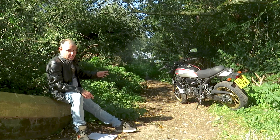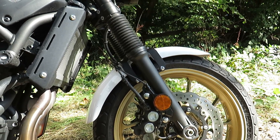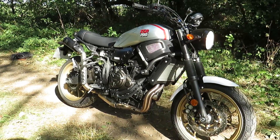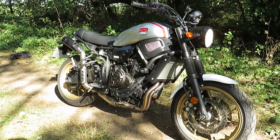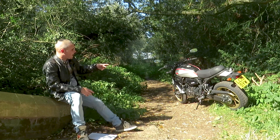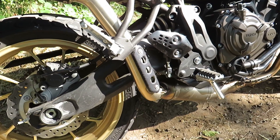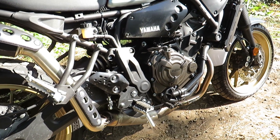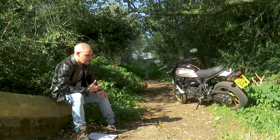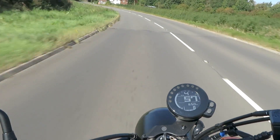It's MT-07-derived suspension, which everyone loves the MT-07 for, but one of the reasons it's a bit bonkers to ride is because it's a little bit underdamped. The suspension's probably a little bit old school — it's designed to keep the cost down. We've got right-way-up forks with nice retro-looking fork gaiters on there, zero adjustment — it is what it is. There's quite an old-school shock absorber on the rear with just manual preload adjustment on the clicker.